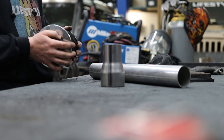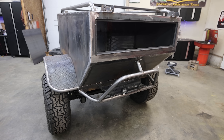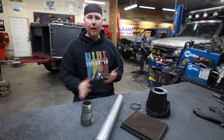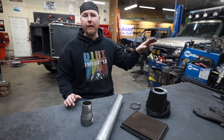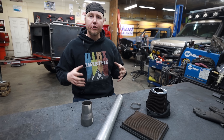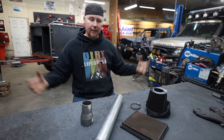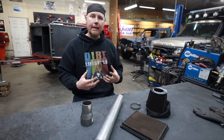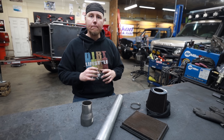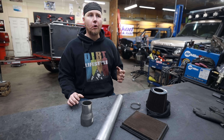We're going to have a problem with this trailer that I don't hear anyone talk about ever. This is going to have problems being weather-tight because of elevation change. I live at sea level, and just going locally up in the mountains where we live, it's going to have a difference in pressure from the inside of the box to the outside. As we go up peaks and down peaks, it is going to be a lung — it's going to breathe dirt and stuff in through our weather-tight seals and then blow air back out. On long trips, this is going to turn into a maintenance nightmare.